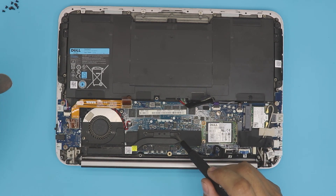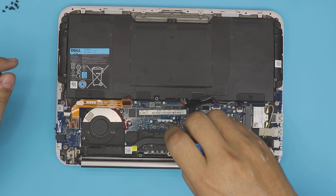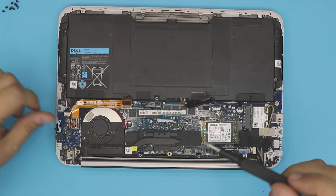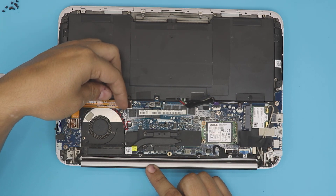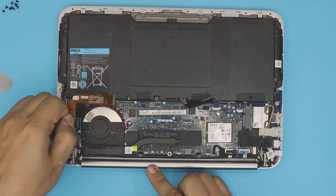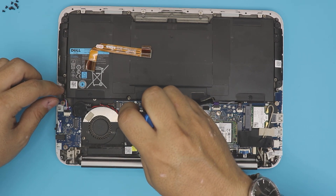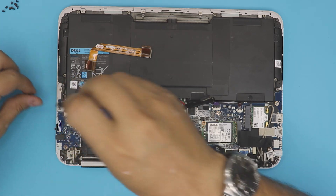We're going to remove four screws on the heat sink. The screws have a C-lock on them so they will not come out completely — just loosen them. We also need to remove the bridge connector: grab the flap right there and pull it up. This connector connects one board to the other. Also remove the fan screw — those do not have a C-lock, so remove them completely.